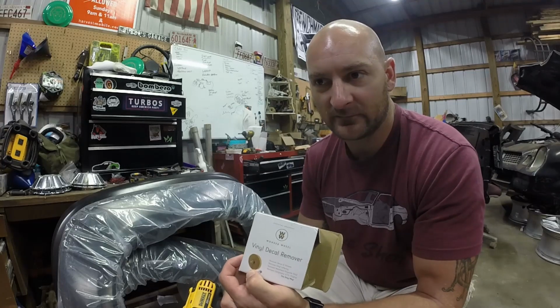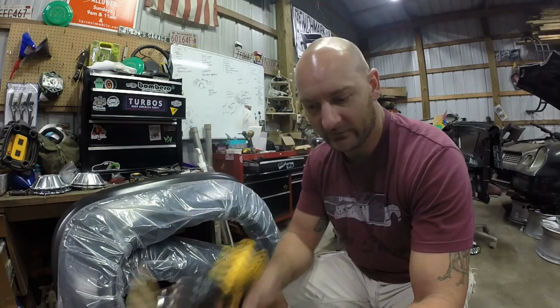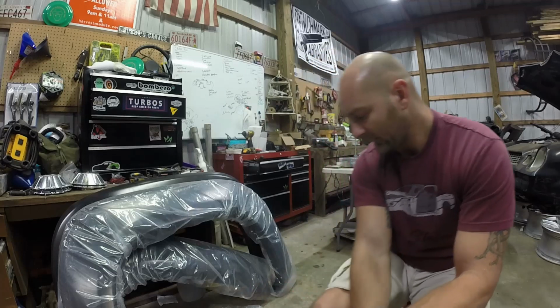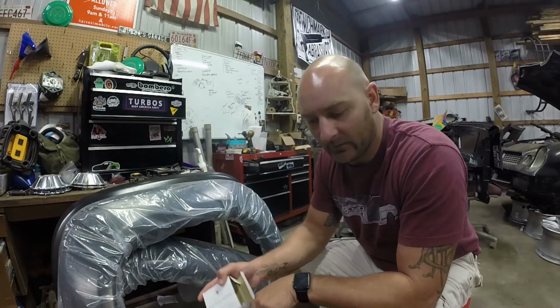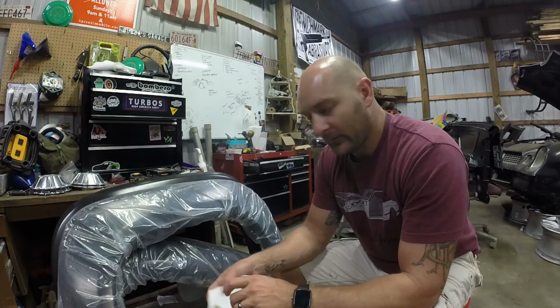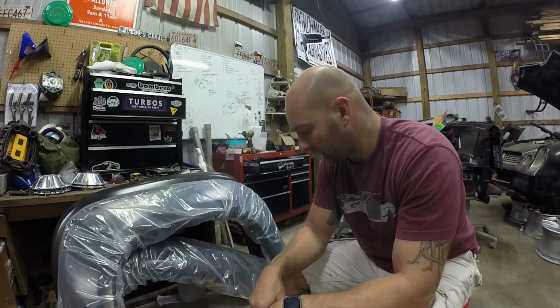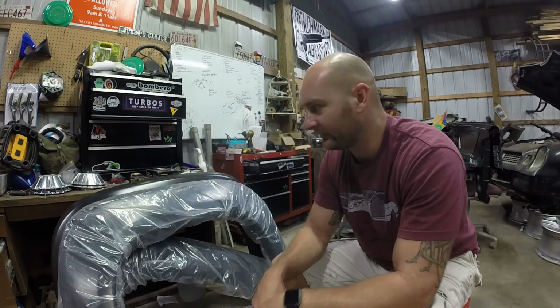In my other video right here, you'll see that it took trim off my Envoy, and to get the glue and the adhesive off, I used this. So using that, it helps out. It'll clean it up. Just watch out, it will burn through the clear coat. And then you gotta basically wipe it down, wash it off, and get the rest of the residue off that it pulls off. So let's get to doing this.